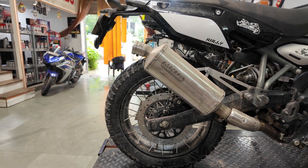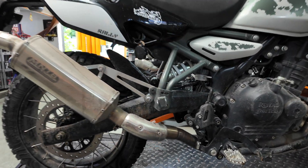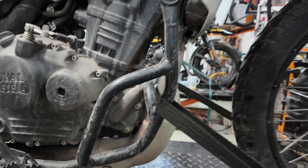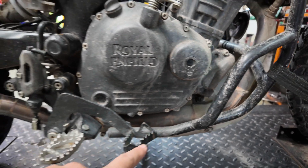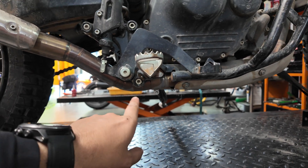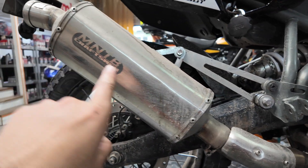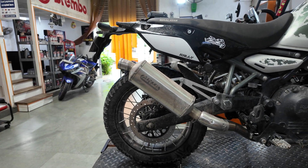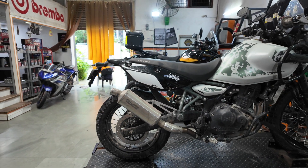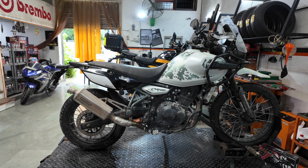Let me first show that to you. This is the MNTB Craftsman Private Limited Rally exhaust. The design is mine and they manufactured it. This works on the Gorilla as well. So this is a slip-on unit with a decat pipe. The header is the same. It has a pre-cat and then it attaches to the decat pipe. The resonator box is gone, and the slip-on comes and meets the exhaust can. It's a very old-school rally kind of look which sort of complements the rally cowl on the motorcycle along with the rally seat.